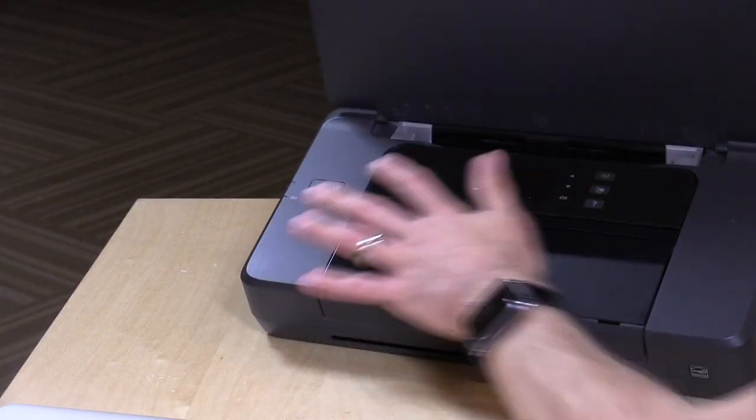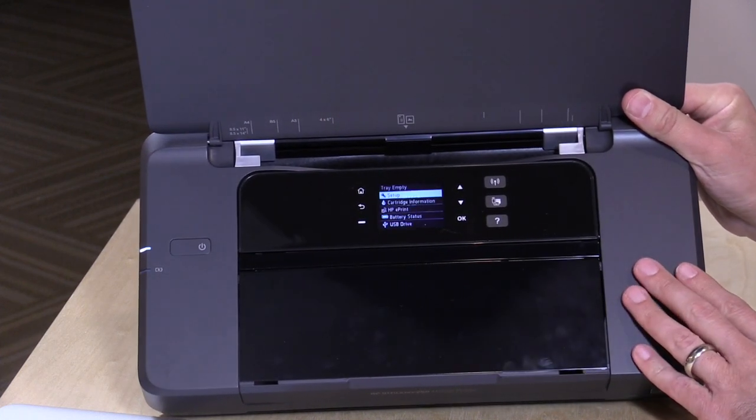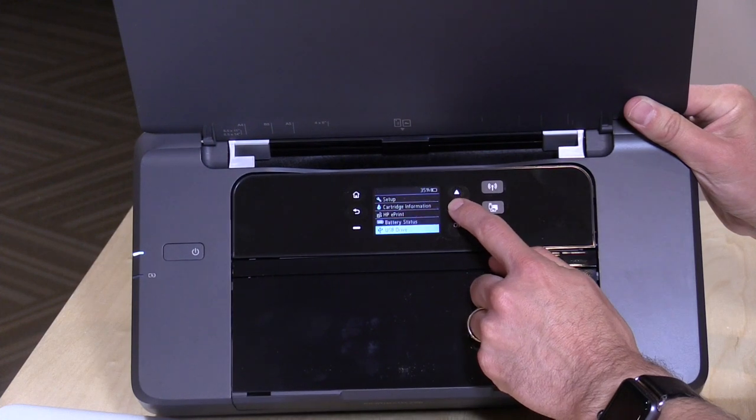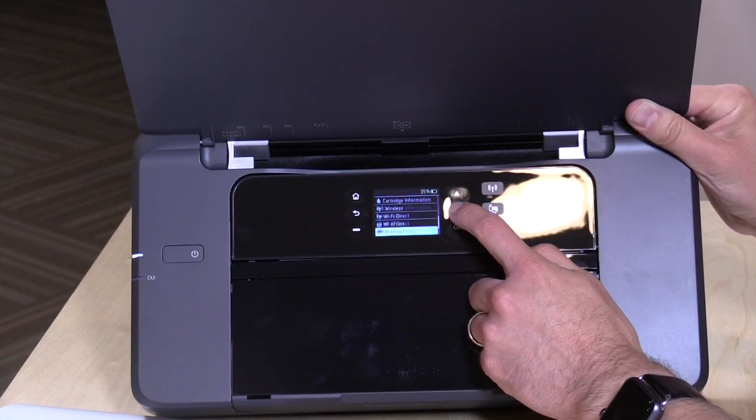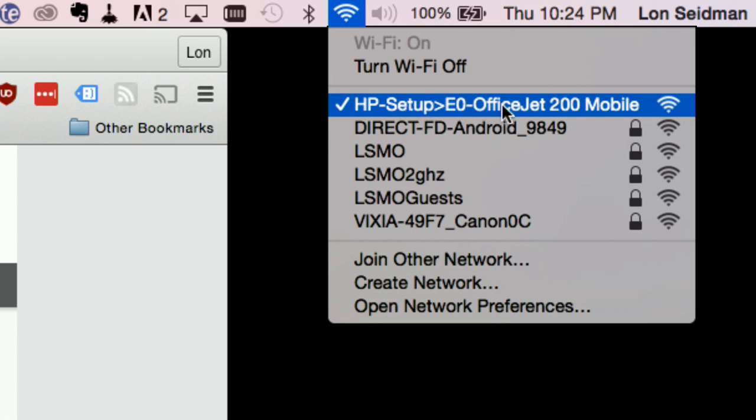There is a small display on the front — it's visible and gives you good instructions on how everything works. I do recommend logging into the printer's web server — it has one built in — which makes setup a little easier, especially for getting Wi-Fi going, because it is a bit of a pain to use the arrow keys to navigate Wi-Fi passwords without a touchscreen. I recommend connecting to the printer's wireless access point from your computer. It will take you off the Internet briefly, but we want to get the printer on our local network first so we can print to it at the office and get all the drivers installed. It needs to pull down drivers from the Internet on both Mac and Windows — it does it automatically, but it needs an Internet connection.